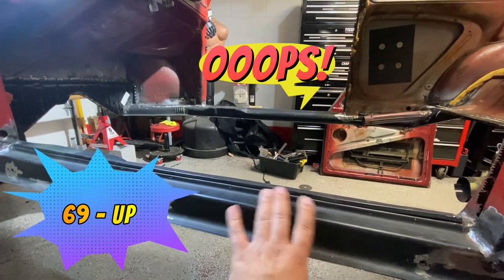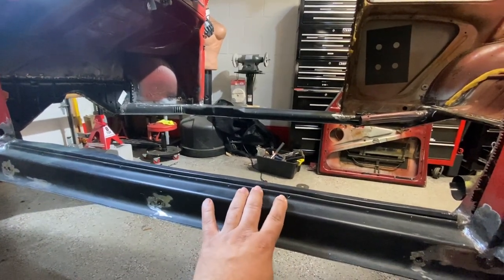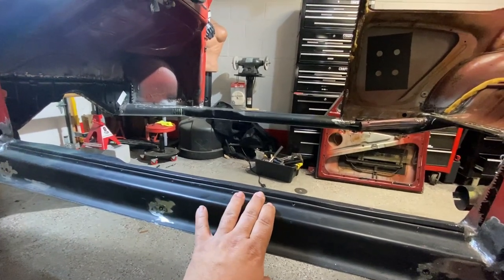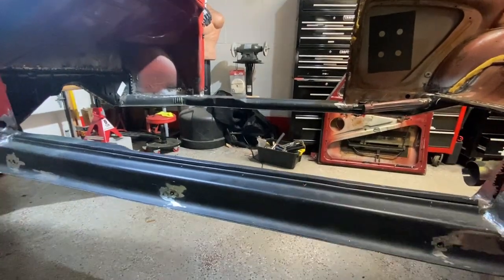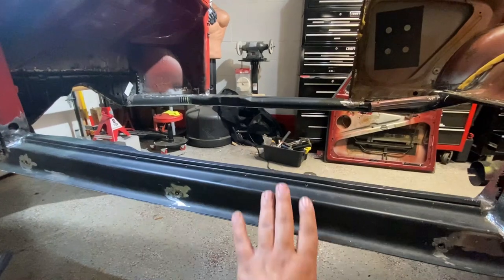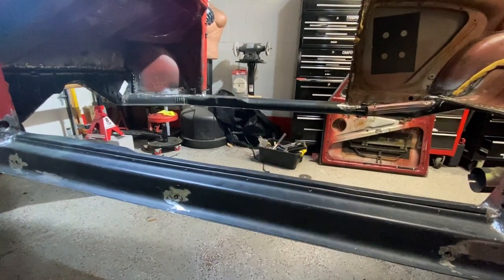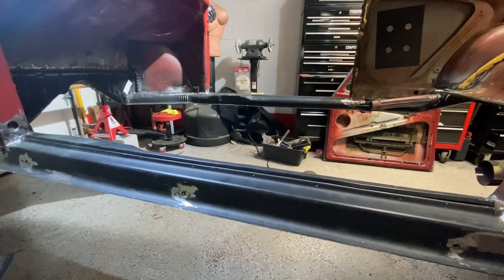The way the carpet works, it has like a rubber trim, and once you pry this open in here, then you slip the rubber trim into here, and then you're able to bang on this to cinch it down. If you look here, you can see the rubber trim on the carpet. It's got like some kind of weird shape to it, and it slips in the channel, and then you hammer it down, and it keeps it in place.